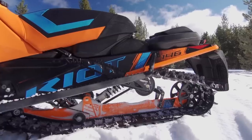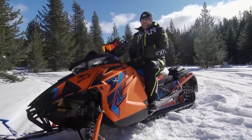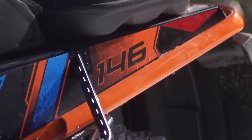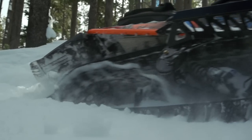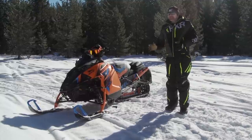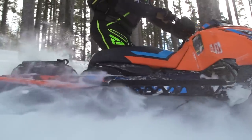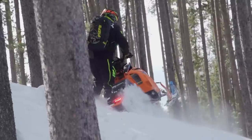While there are a lot of benefits to utilizing a 146-inch version of the Alpha 1 skid in the Riot X, this move also comes with some drawbacks. First and foremost is on-trail ride and handling. The Alpha 1 was never designed to be used on the trail — it's a very specialized setup designed to work in the deep snow. So it wasn't ever a surprise that Alpha-equipped Arctic mountain sleds didn't ride very well. Because the rear of the sled is so tippy from side to side, Alpha-equipped mountain sleds also don't handle very well on the trail — they tend to roll up onto the outside ski basically all the time. The Riot X is supposed to be a crossover sled, an off-trail bias crossover sled, but a crossover nonetheless. Alpha 1's harsh ride and tippy handling traits pretty much erase any of the positive on-trail handling traits of last year's Riot X. Despite Arctic Cat's claim that it's still a crossover this season, it is my opinion that the 2021 model is an off-trail only sled.